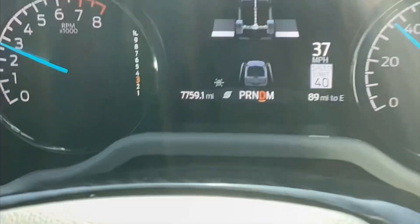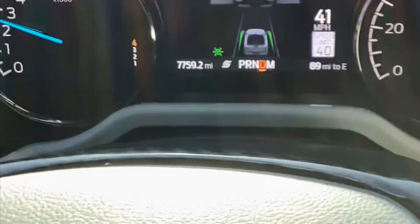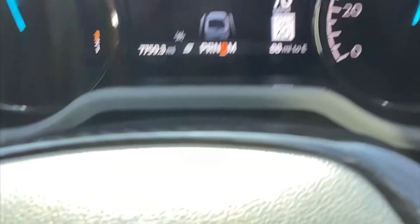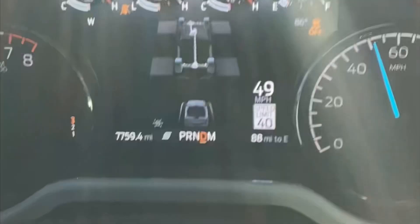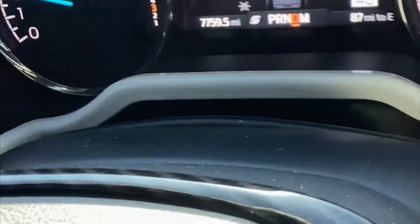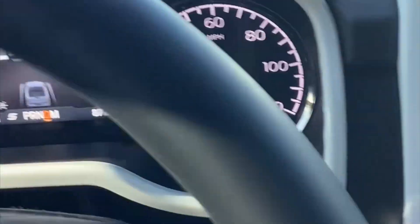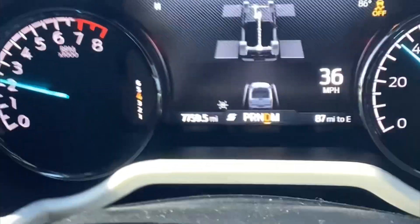They want you to do a log that holds third gear, and I couldn't figure it out. Then I figured out how you do it — this is the first time I've ever had one of these trucks. You can delete all your gears here and then hold a gear; hopefully it won't shift. We've got a long straightaway coming up. What the tuner wants me to do is hold the gear up to 7,500 RPM. It was always shifting before in manual mode, but now I won't be in manual mode — I'll use the gear delete method instead.